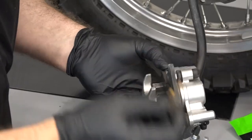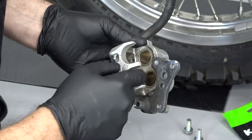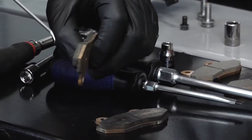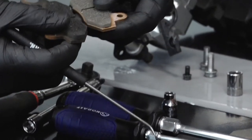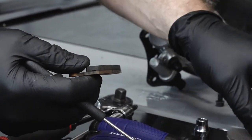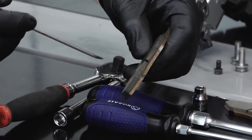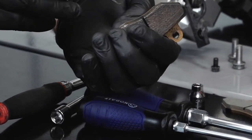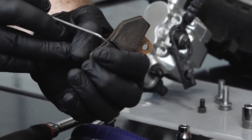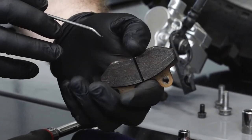They just lift out. I don't see any leaking around the seals, so those look to be in good shape. The pads I took off are practically new. If you go ahead and compare them, there's barely any wear at all. What you're looking for if they were worn out — the wear limit is one millimeter, which is about the thickness of this channel right here. Well, if you can't see this channel, your brake pads are done. At that point they need to be replaced.